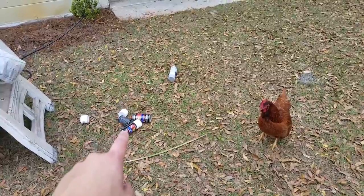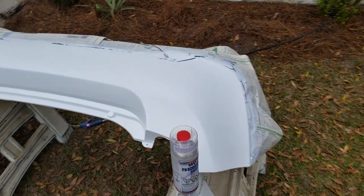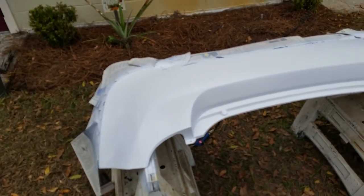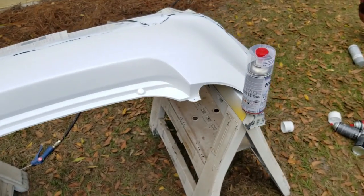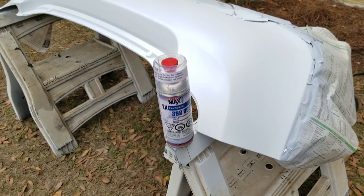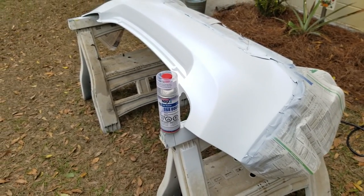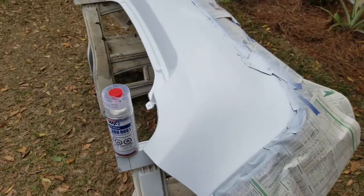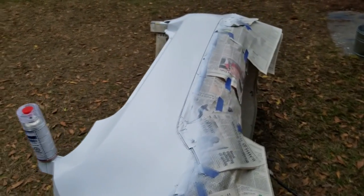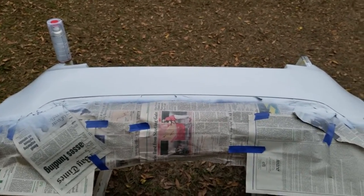Now for this stuff right here — this is the real deal clear coat. If you're going to be using a spray can, you want to try and find this. I bought this at a specialty automotive paint store; they also sell it on Amazon — link in the description box below. This has a hardener in it like they use at regular body shops, meaning your finish is going to have a nice shell and really good gloss. The Duplicolor clear coat I don't recommend — I tried it on a touch-up job and it hardly looked like there was any clear coat. So let's spray this and see what the finished product looks like.